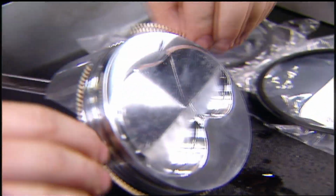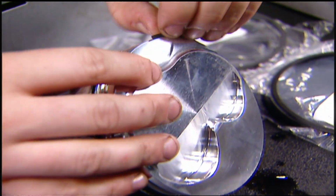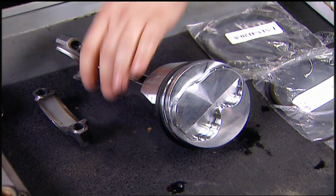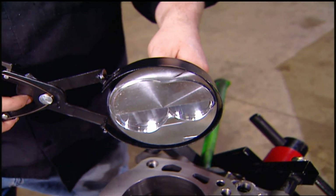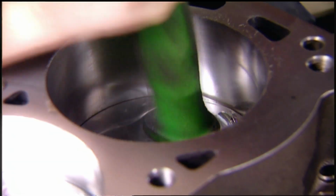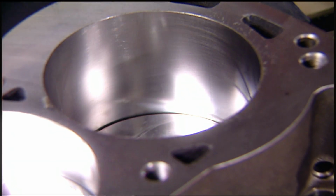But the extra horsepower is with the rings. The total seal rings operate without a gap once installed. This allows the rings to have less tension on the cylinder walls without losing compression. This will actually build more power in the engine because of less friction.